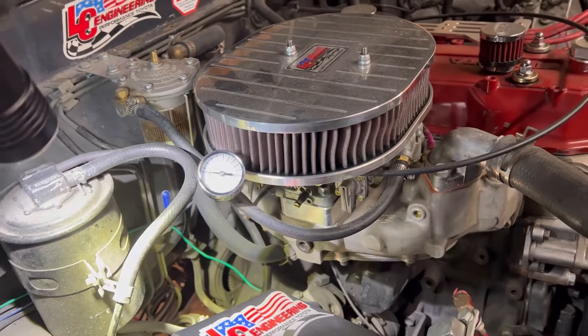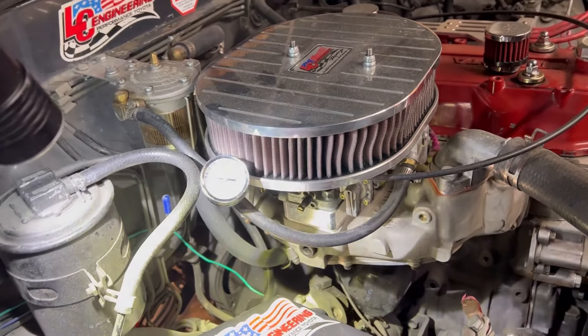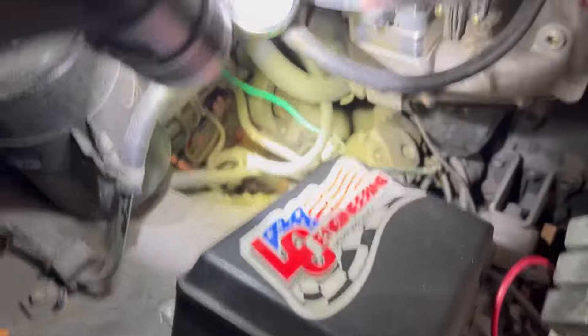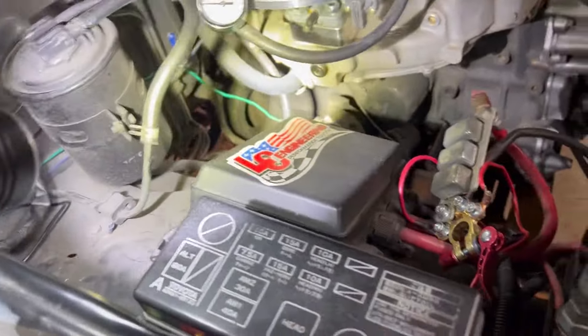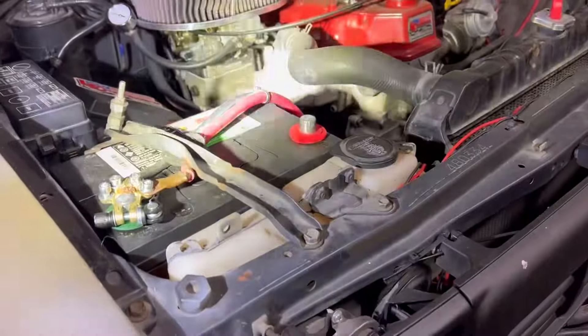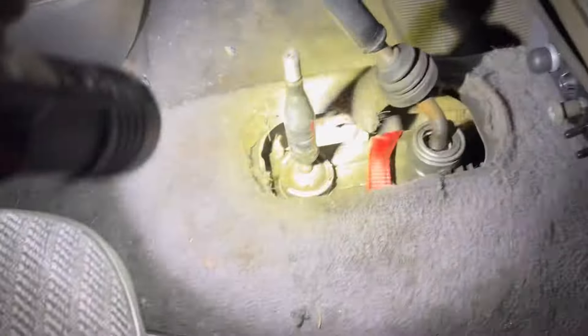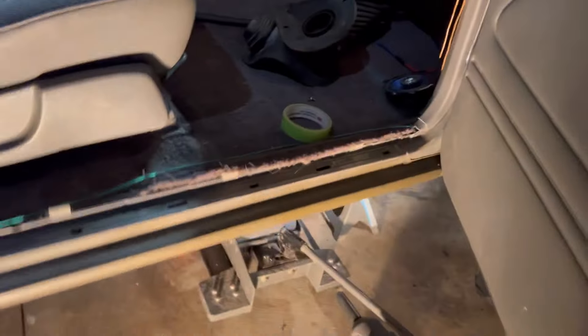What's up YouTube. We're going to do the checklist of what you need to do before the transmission is dropped. You want to have the starter taken out, which I've done. Before you take the starter out, you want to have this disconnected. You also want free access to this whole area — you don't want anything hanging you up. If you have a stock exhaust system, there is a bracket you're going to need to undo.